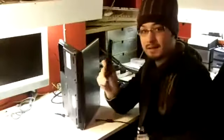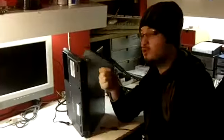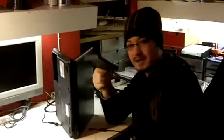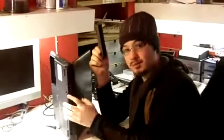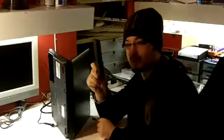So what I'm saying, the main goal is when you do these tests, don't bother using the battery or testing the battery. Always keep it out, because we want to get the laptop to work just with the charger, not with the battery. I haven't even used it for tests, okay?